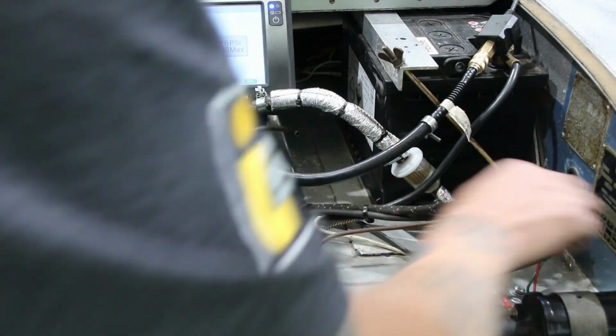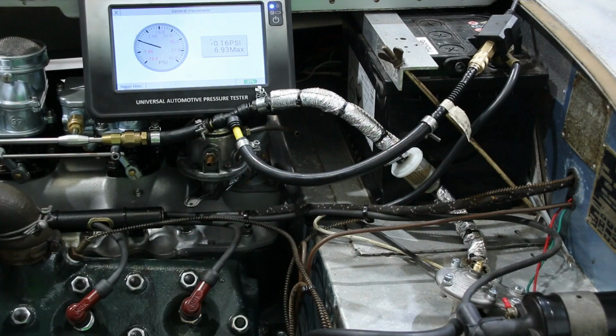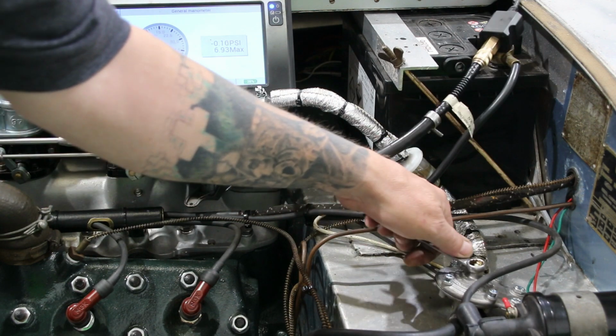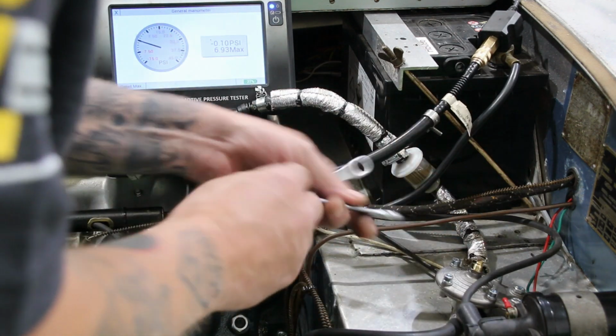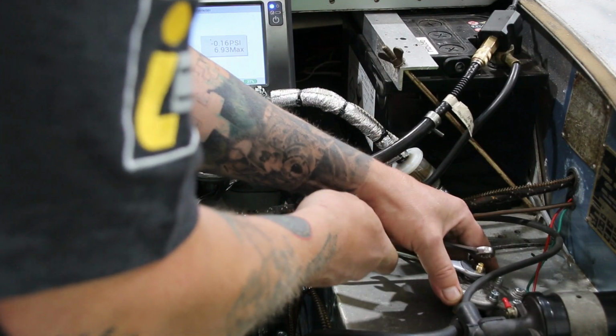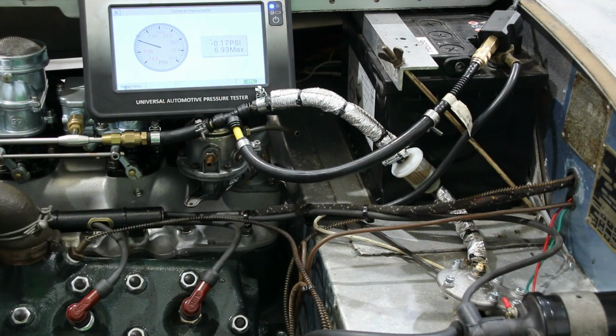A cap, right. I think what we should do is crack off this. This will be the lock nut, and then we turn the centre with a screwdriver, but we'll give it a try. So that must be a 7/16, so we'll find a 7/16 spanner. There we go, a little crack. No, it's not. What size is that? It ain't. Oh, that might even be metric. So that's the lock nut.